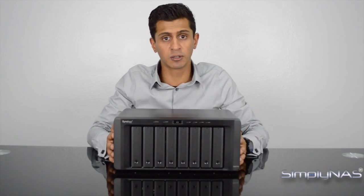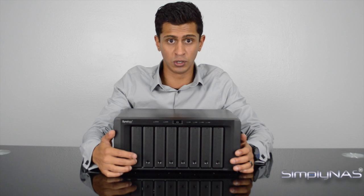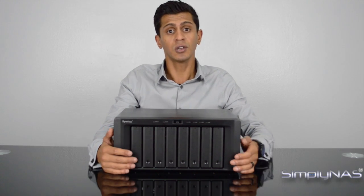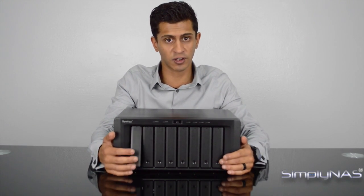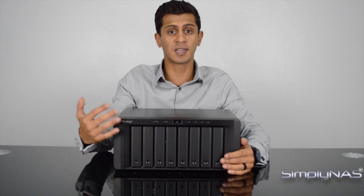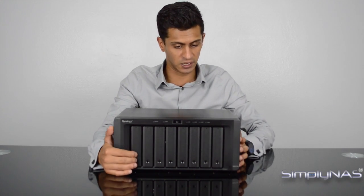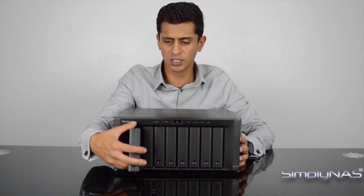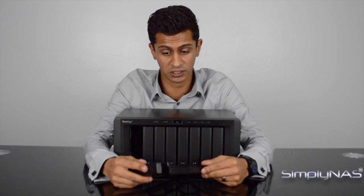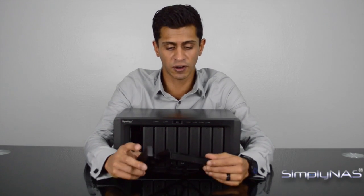The unit itself is plastic-based rather than metal like other NASes, but we find it to be quite rigid and have no issues with the build quality. When we ship these to you we lock the hard drive bays, as we've had instances during shipping where trays come loose — to avoid you powering up with a loose hard drive and losing your RAID array from NAS fit testing. Make sure you unlock the unit before removing drives so you don't break the trays. Synology hard drive trays are completely plastic and the latch breaks off very easily, so be careful.